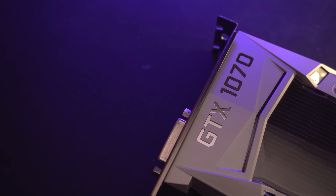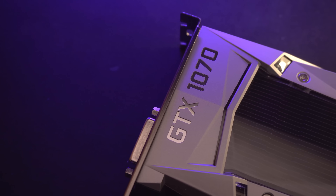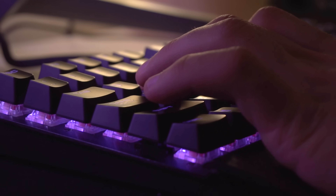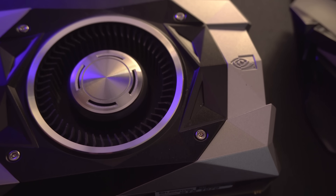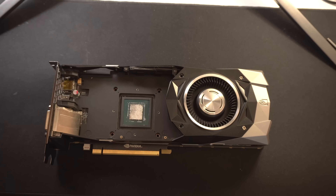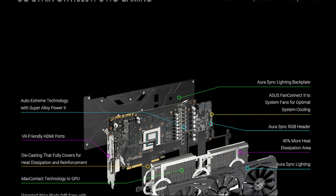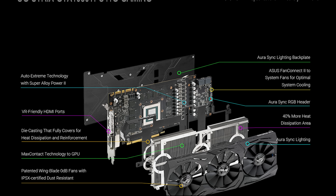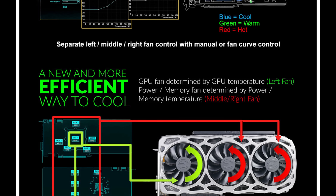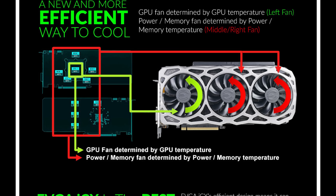That's not to say you won't have success applying it to both — just remember to use really thin layers. In my initial video I concluded it wasn't really worth applying liquid metal to a GPU given the small three-degree drop I experienced on my Founders Edition card, but many of you have since reported drops of up to 15 degrees. It seems that with blower-style cards the thermal bottleneck isn't thermal conductivity between heatsink and GPU, but rather heat dissipation — it doesn't matter how well you're conducting heat if you can't dissipate it. In contrast, open-air coolers from MSI, EVGA, and ASUS with up to three fans have adequate cooling, so the bottleneck is thermal conductivity, which is why liquid metal produces a large temperature drop on those cards.